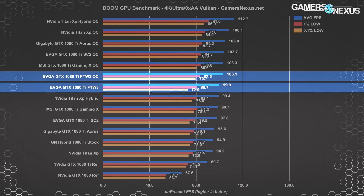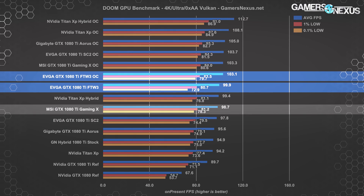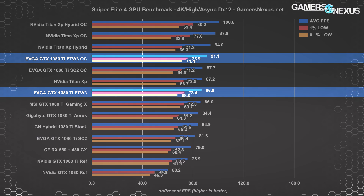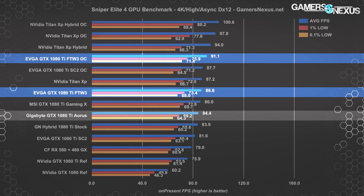Running Doom with Vulkan at 4K, the EVGA 1080 Ti FTW3 is once again the fastest stock card on the bench, even versus the Titan XP, outperforming our Gaming X by about 1.2% — not jaw-dropping and partially accountable to chip-to-chip manufacturing variance, but a lead nonetheless. The FTW3 also outranks our Gigabyte Xtreme card by 4.5%, as the Xtreme Aorus runs into power limits under stock conditions. In Sniper Elite 4 with DX12 and Async Compute, the FTW3 again tops the 1080 Ti listings, just barely ahead of the MSI Gaming X — effectively identical and within test-to-test variance. We're about 2 FPS or 2.8% ahead of the Xtreme card. Additional game benchmarks are in the article linked in the description.